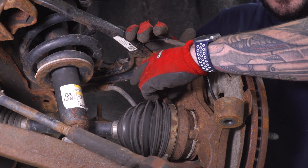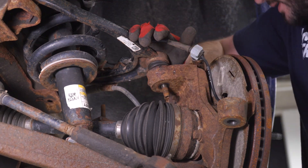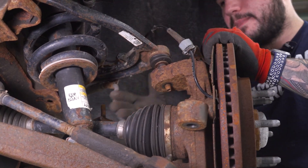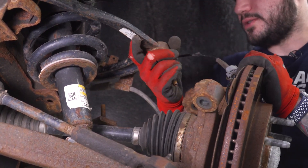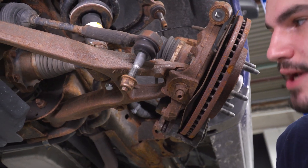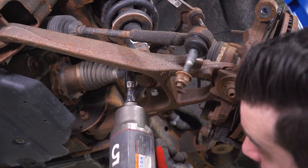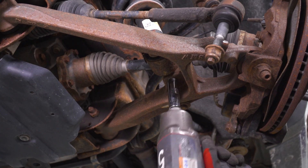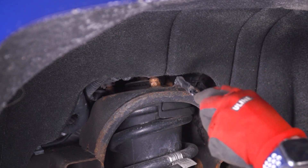Swivel the knuckle out, push down, and remove the nut. Once that nut is off, the upper control arm is gonna pop out — just be there to support it. Make sure the lines are out of the way. Now remove the two bottom strut bolts — they're 17 millimeters. Keep in mind, once those two come out, the entire lower control arm is gonna drop down, so just watch your head. The next step is to remove the top three nuts — they're 18 millimeters — and then the entire strut will come out.